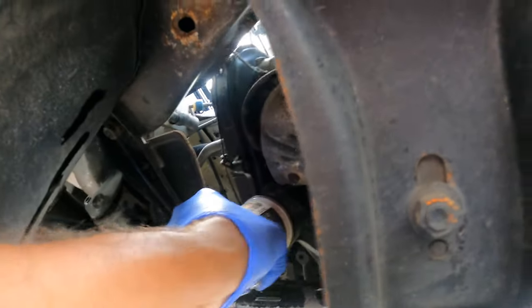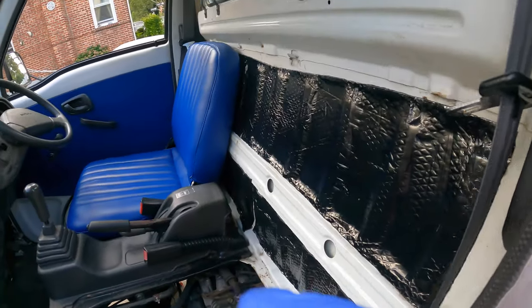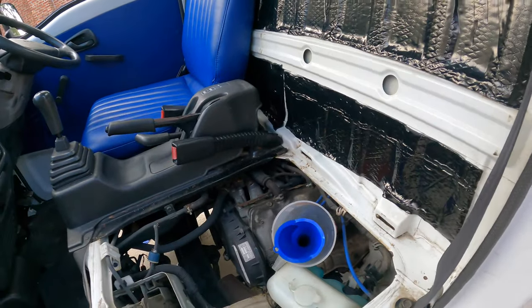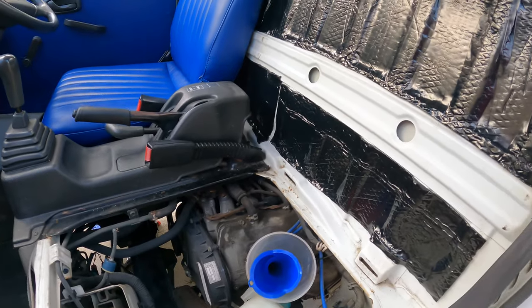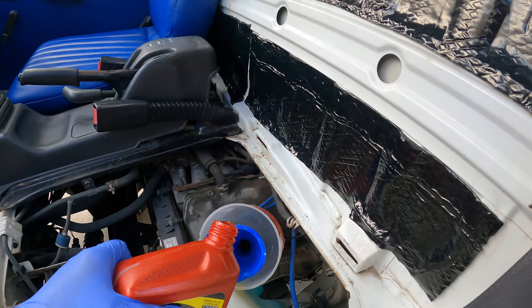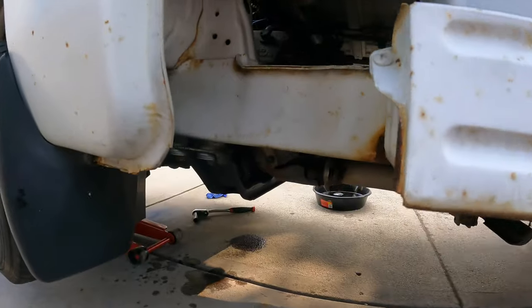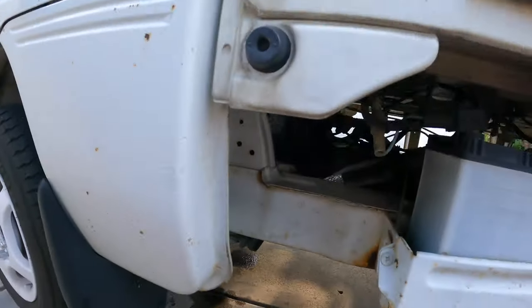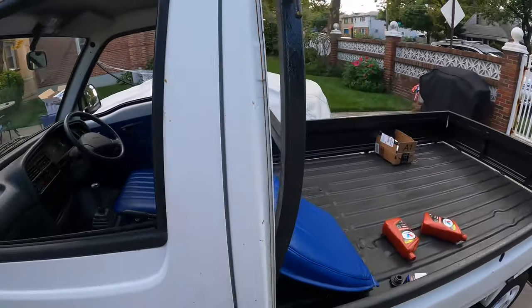You just want to have it snug. You don't want to have it too tight where the next time I'm going to have to take it off, it's going to be a complete pain. We just got that done. I made a little mess, so let me go clean all that up. Once this is done, I'm going to definitely clean under there. New filter is in. Time to put in some oil. I took out the whole seat just because I didn't want to get any chances of getting oil on the nice beautiful seat. So we're going to put the first quart in while the truck is still elevated, then I'm going to drop it. I just want to make sure nothing is leaking because I ordered a Wix one but got that. Let me make sure there's nothing leaking under here. Everything looks good. So now let me drop the car, and now let's put our other two quarts of oil.